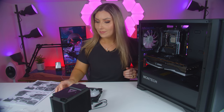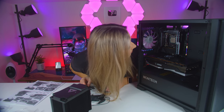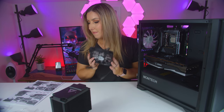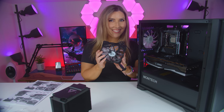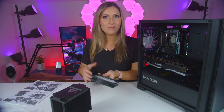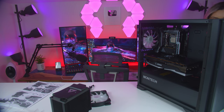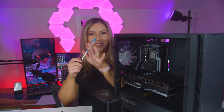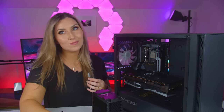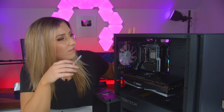And yeah. Before you actually put the CPU cooler in, is there something you could do which would make your life a lot easier before you put that cooler in? The fan, right? First of all, there's a plug on the motherboard that needs a cable in there. So if you put the cooler in first, it's going to be very hard to reach that. Next step. So you've got the CPU cable plugged in, and we've decided we're not going to put any extra fans up the top for now. So we're going to do thermal paste.